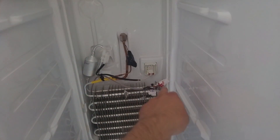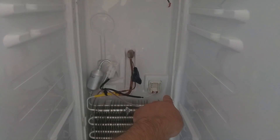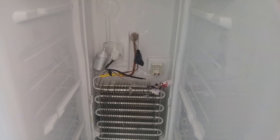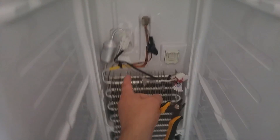I've disconnected the middle connector, which is two brown wires, fairly thick, and they go in a big loop all the way around. I'm not sure what that one's for yet, but the error message is the same, so that's not it. I reckon those two white wires going to that metal sensor there are going to the defrost sensor. I've tried re-plugging it a few times but it still comes up with the error, so I think the sensor's bad.